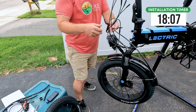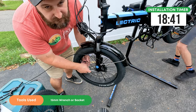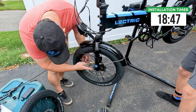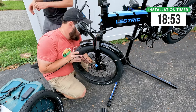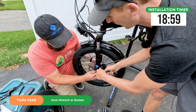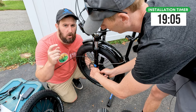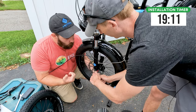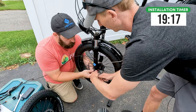Now that we have the brake removed, let's take out that front wheel. The nuts on the side are bolted right and left — these are 15s. Just put the wrench on there and give it a little twist. There is also a little torque on there that holds the wheel so you don't have to worry about it falling off as soon as you loosen both nuts. I'm also going to start taking off the mount for the mechanical disc brake using the ratchet wrench. Be careful on some of these bolts as they are pretty tight. If you have a ball-end Allen wrench, try not to use the ball end — you can either snap it off or strip the bolt, because the ball end doesn't give you a hundred percent engagement like a normal socket.